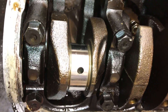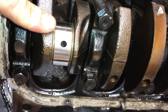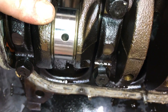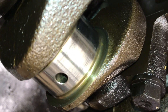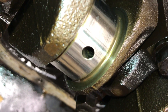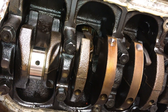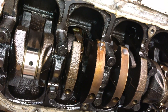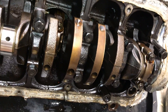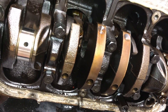Just a couple of minor little things. This shiny smooth bearing surface on the crank — you definitely do not want to be touching that with any tools. You want to try to avoid any scratches or imperfections in the surface. This one, if you get the light right, it's just got a few minor little scuffs and a bit of a polish should bring that up okay. Another thing — you're going to try to keep everything in order. You don't want the wrong piston going back into the wrong bore once reassembly commences, so it's important to have everything labelled. That includes all the caps on the big end bearings — everything has to go exactly where it should be.